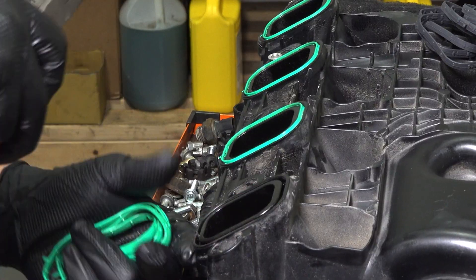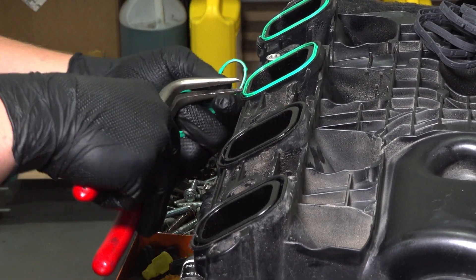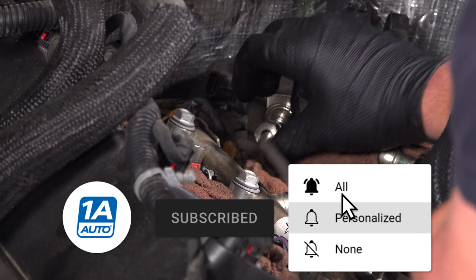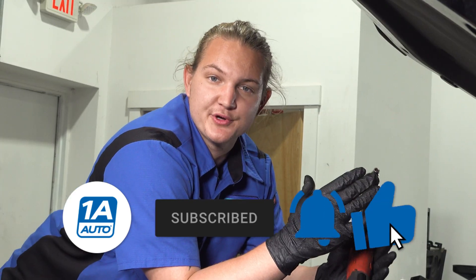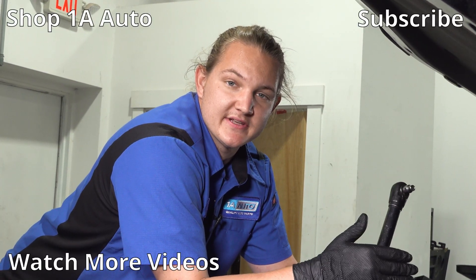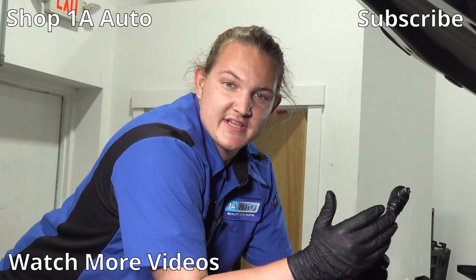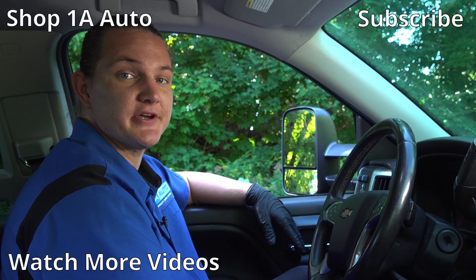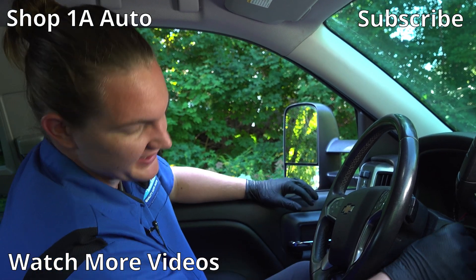We have the truck all back together. We put the fuel pump fuse back in and it's ready to go. The big three things with this job are: you're going to want to replace your intake manifold gaskets, you're going to need to replace that crushed fuel line, and the last one is if you've had these symptoms, you're going to want to do an oil change right away. This is because the fuel has gotten into your oil and thinned it. This thin oil can cause damage to your camshaft, and we don't want that. Let's give it a start and then turn it off and make sure we don't have that dieseling anymore.